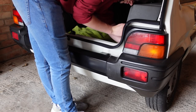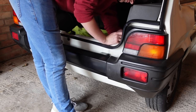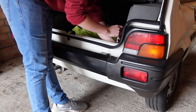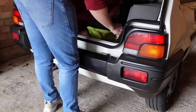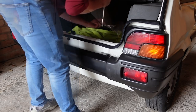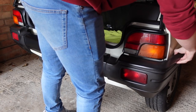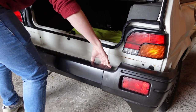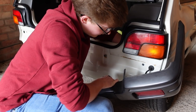This 1.1c bumper is in three sections, the centre part of which is metal, and there are four bolts holding the bumper to the car. Two of them are at the sides and connect to the plastic sections, and then there are two in the centre which hold on to the big metal centre section. Once these are removed, it is a simple case of pulling off the bumper.